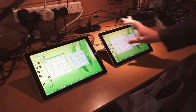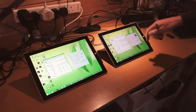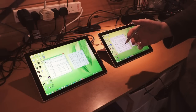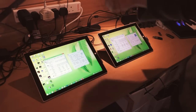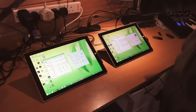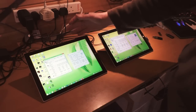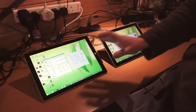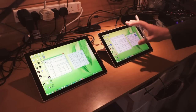which is really interesting because potentially this means that the Surface 3 is going to be more stable using music applications. With the Surface Pro, you get so far and you load up a whole stack of plugins, but when you hit a certain temperature, you then have to unload quite a few plugins to bring the temperature down as the fans come on, and it needs to sort itself out because it clocks down and ruins the performance. Whereas here, potentially, it's not going to do that.